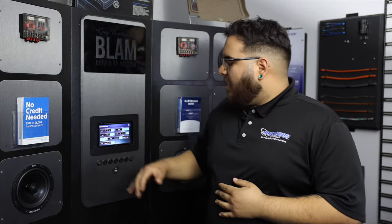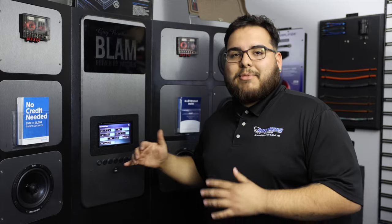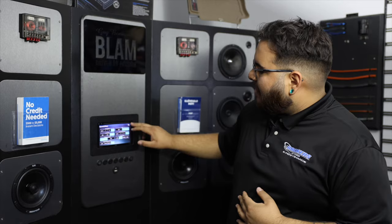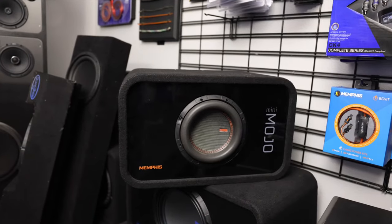What's up guys? This is Jake from Breaker Stereo. Just wanted to give you a quick tip when you get your new radio. When you get a new radio, seeing bass boost and loudness in the settings is very tempting, but never ever touch them. We get a lot of customers coming back for warranty work because they blow out their speakers by using bass boost and loudness. When we check their settings, those are turned up high and their equalizer is just cranked up like crazy. Instead, consult with a technician, or if you're really looking for bass, get a sub with an amplifier. That'll help you out.